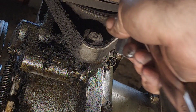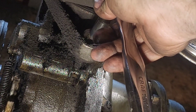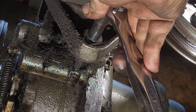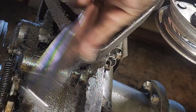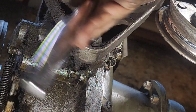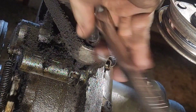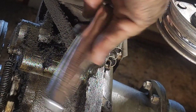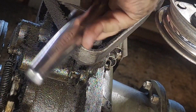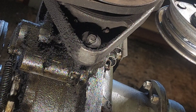These gearbox clutches don't get serviced. There's a good chance that the clutch material on these discs has worn away substantially over the years. I'm just going to thread this nut in — we're going to pull this yoke and the main drive disc further away from the cone.